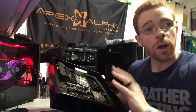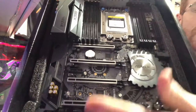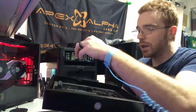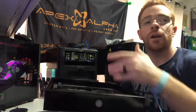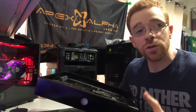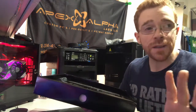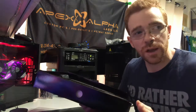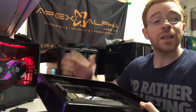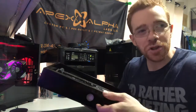On a motherboard you'll notice all these little chips and ICs. You can identify things like the BIOS flashback button on this board — you have the power connected, put in a USB, and that's how you flash a BIOS without installing a CPU, RAM, or video card. But if you want to check that your motherboard is what you paid for — most B550 or AM4 AMD boards — you can get one with the latest BIOS, or one that's been sitting in a warehouse and ships with revision 1.01, the original factory BIOS.